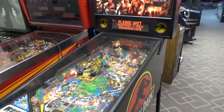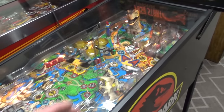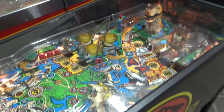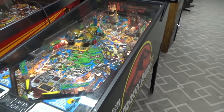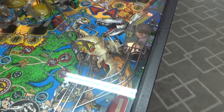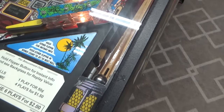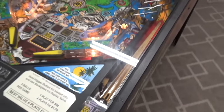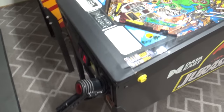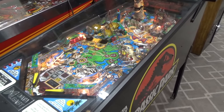This game still has about three problems. One is the T-Rex is not working right — he's supposed to go right, then back left, find center, go down, eat the ball, then go back up. He's not doing all that; moving right seems to be the main issue. Then there are a couple solenoids that don't work: the up-kicker, the popper in the middle, and the auto launch ball coil. That's a real problem because on this game there's no plunger — you hit a button or pull a trigger — and it doesn't work in test either.